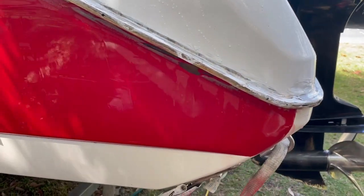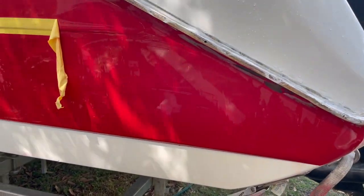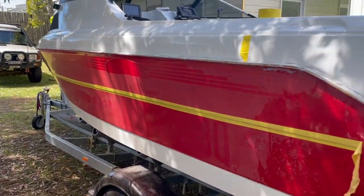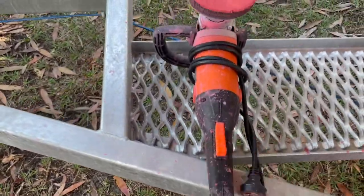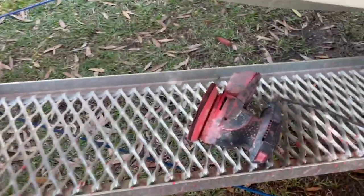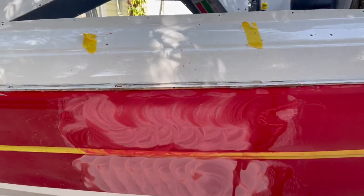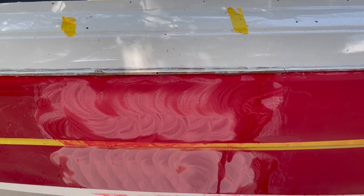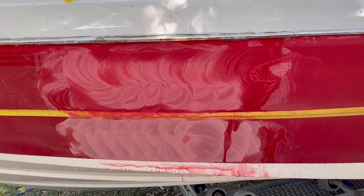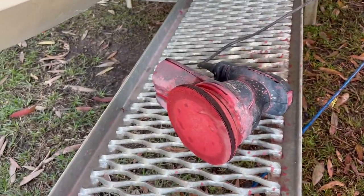The letters and old badging at the back are now sanded out. That took about eight or nine passes wet sanding with the 400 — there's a lot of work just doing the 400, it'll take most of the day. My new big polisher also burnt out — water got through it — so I resorted back to my little trusty Bosch dual action. Having done a few sections now, it's really not that much slower than the big rotary and it's a lot more controlled without deep scuff marks — maybe 20-30% slower but I'd honestly recommend it for the job.